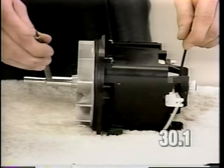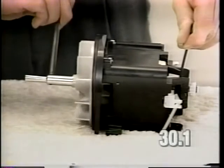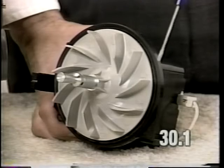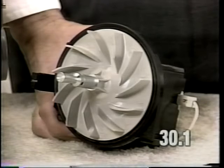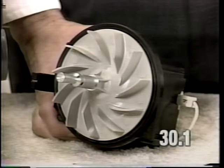Prior to installing the motor assembly into the base subassembly, check the motor seal for damage. If damaged, install a new motor seal. To reduce the risk of improper installation, apply an engineering-approved sealant to the motor seal channel of the bearing plate prior to placing the motor seal in the channel. Approved sealants are Permabond number 102 and Loctite Superbond number 414.